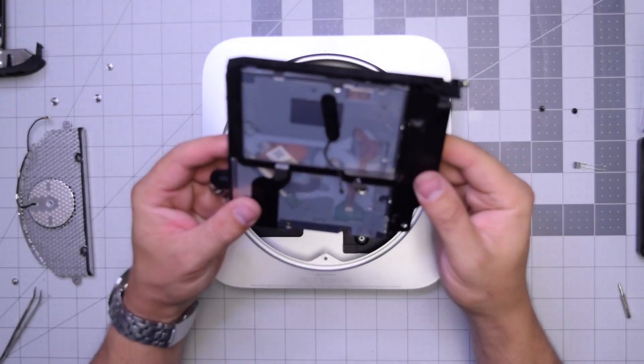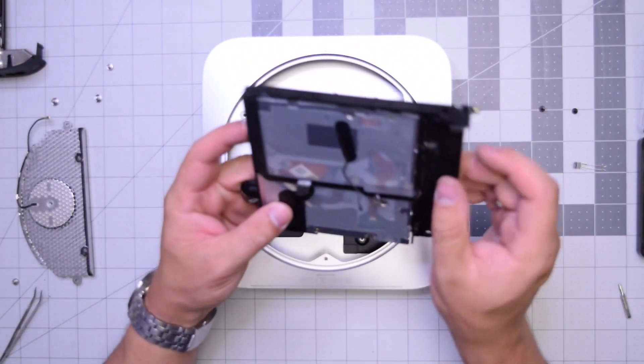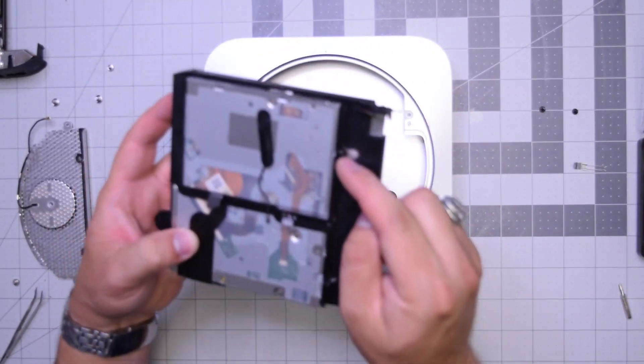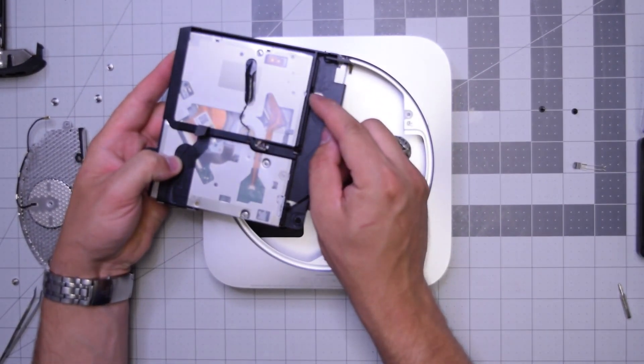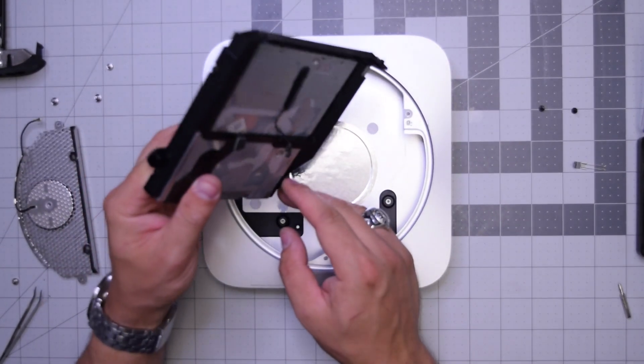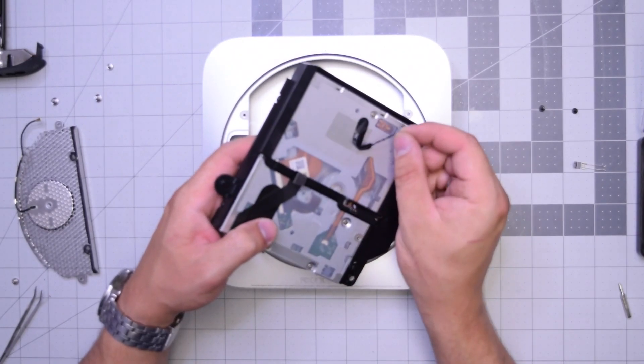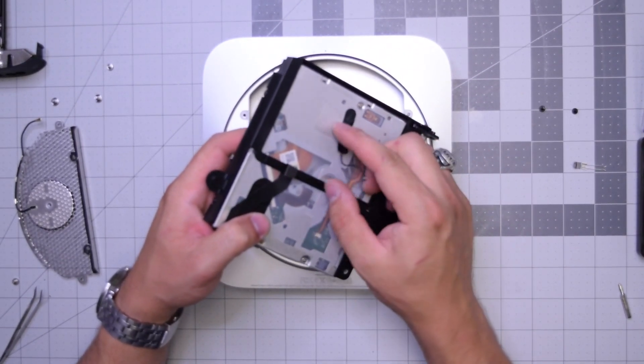Taking a look at the DVD drive, you will have to remove the screws on the frame. There are four screws on each side — go ahead and remove those and take it out of the frame, then transfer over that sensor right there.